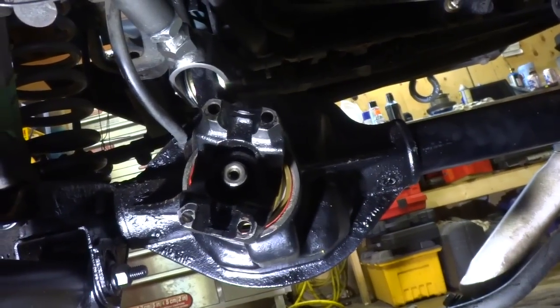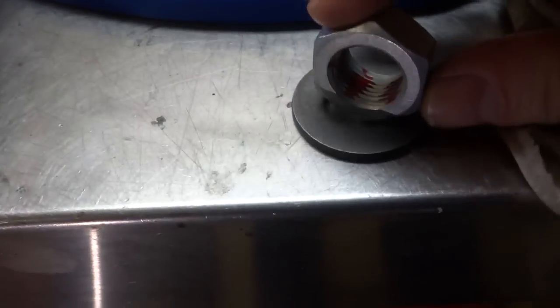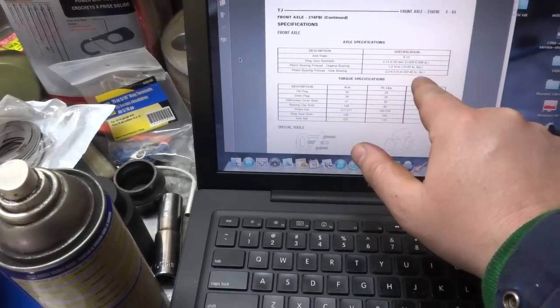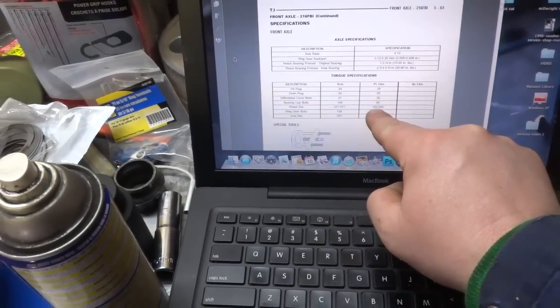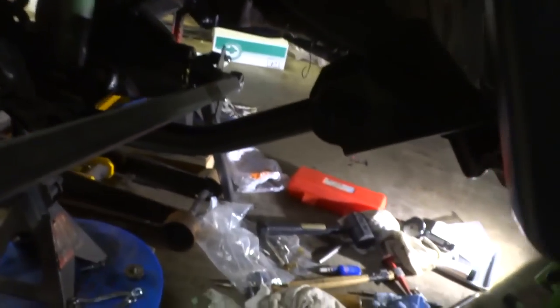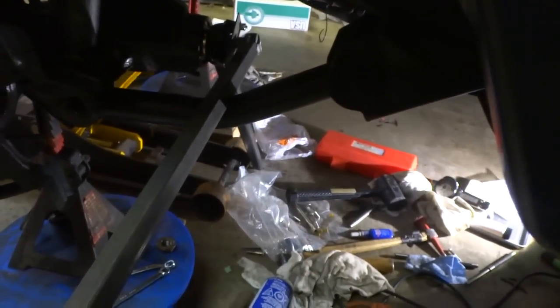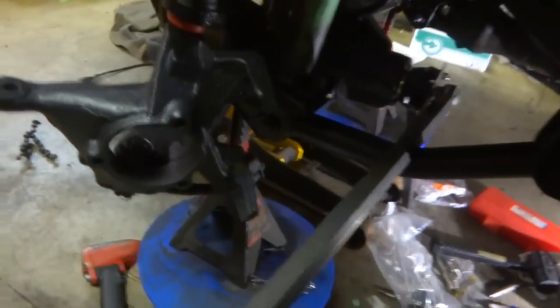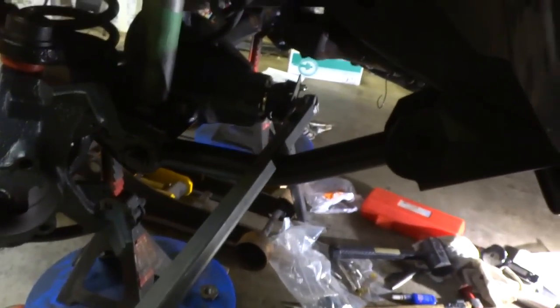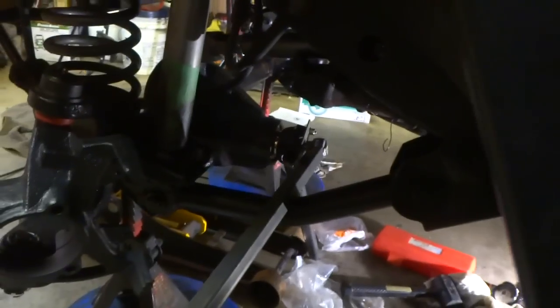I got some red Loctite on that, so we're going to slap that on. According to the service manual, to get 20 to 40 inch pounds on the pinion to turn it, we have to be anywhere between 160 to 200 foot pounds of torque. When they say you've got to use a snipe to tighten that pinion, they're not joking. I went through the control arm — that way when I went up I had about a few inches; otherwise if you try to go from the bottom to the ground it just doesn't work. I made a brace that works really well. I kept tightening it, checking every so often — three or four tightens, grab the pinion, see if it wobbled and how loose it was. Finally I got it, so I'm going to take that brace off, tap the pinion, move it around a few times, and recheck my preload.